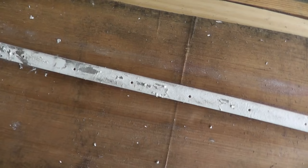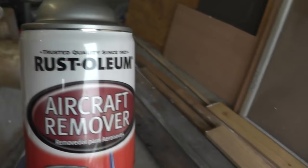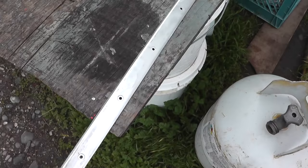I don't have unlimited time or sandpaper, so it's time for Plan C — just drive up to Wally World at 9 o'clock and pick up some paint stripper. This is Rust-Oleum Aircraft Remover Professional Grade, which, interestingly enough, is not for use on aircraft. The great mysteries of life. I applied three coats on the aluminum this morning, let it percolate for a while, then went after it with a wire wheel, and just like that, I have a classic brushed aluminum finish.